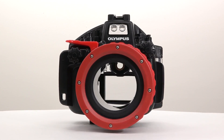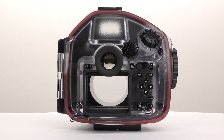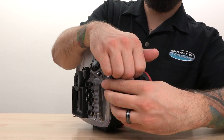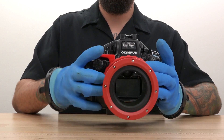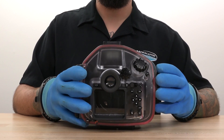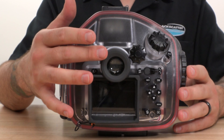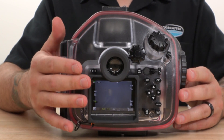The PT-EP14 underwater housing is the deepest rated Olympus housing to date, allowing you to take it down to 197 feet. It has a shoe mount on top to support a variety of lights or accessories, and fiber optic strobe connectivity through the pair of connectors on front. It has a locking latch for both the main door and the port opening, both of which are really simple to operate. The housing features oversized knobs for easy control even when wearing thick gloves or a dry suit, with dedicated dials and buttons for all essential controls such as the AEL AFL button and easy access to the 2x2 switch. The standard pickup viewfinder allows full vision of the camera's viewfinder so composing your images is easy even through a dive mask, or you can easily work off of the LCD screen.